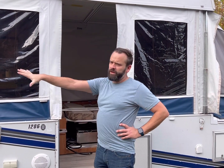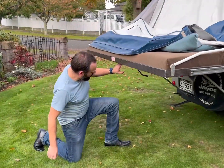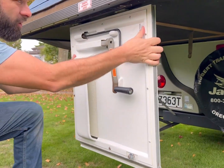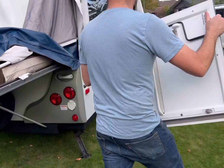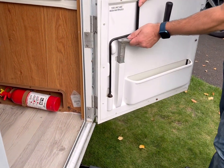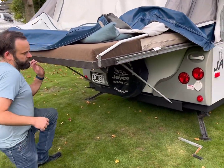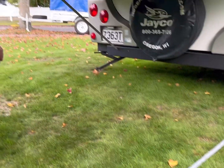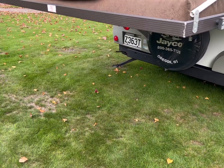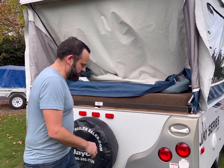We've just stored the door away and are now going to pull in the ends and wind it down. Coming around to the rear of the camper — the entrance door underneath needs to be moved before we try and slide it back. Unclip the button, drop the door down on its hinges, slide it out and bring it back, put it on the side of the camper — it simply slides back in. Grab the winding handle while we're there. Coming back to the rear, we lift it, slide it out of the bracket, pull that pole out, and do that on both sides of the bed. Both poles go under the mattress — that saves any confusion.